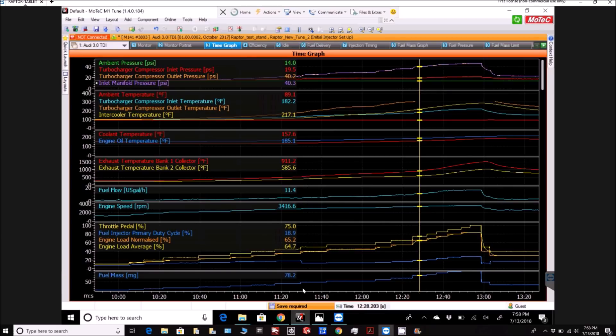It sort of correlates just after where the intercooler temperature started to really ramp up. My thinking is that what's happening is the intercooler is getting a little bit heat soaked and so it's not doing as good a job. Ultimately more hot air is going into the engine with more compression in the cylinders as the power ramps up, so you get more hot air coming out in the exhaust.